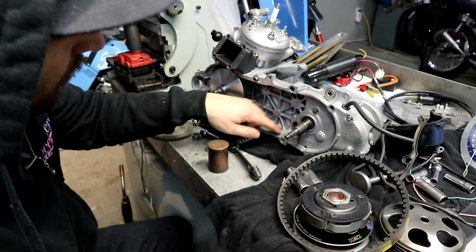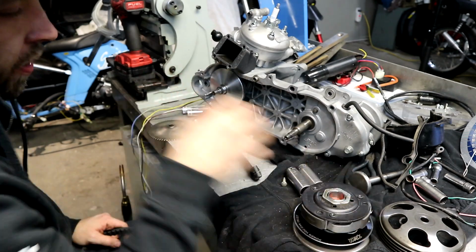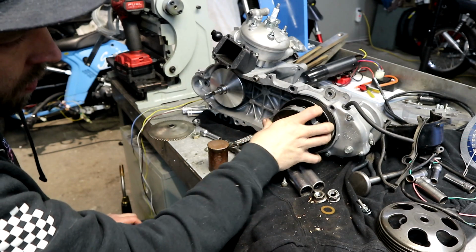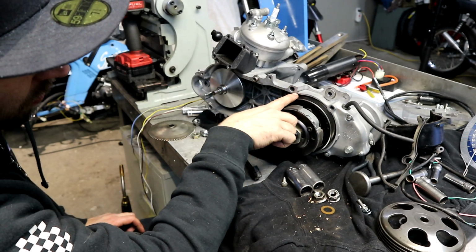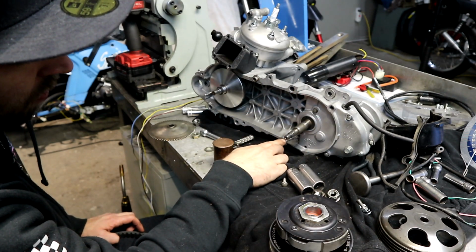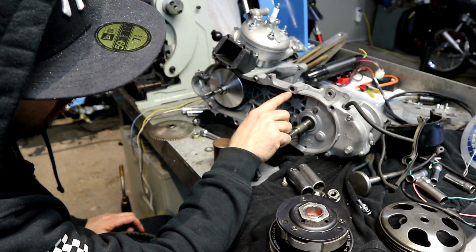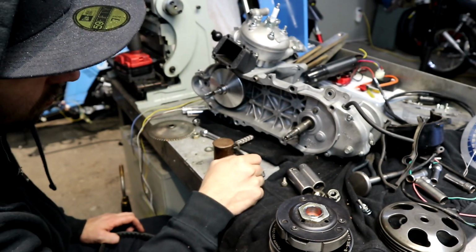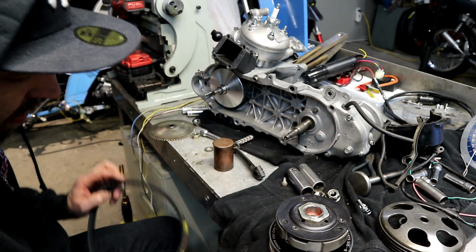And there is one more thing I'm going to have to do. When you're running these pulleys, with the grinder as well, the belt rides up so high that it rubs along the edge right here and also on this. So you basically need to remove that lump, flatten it out completely, and the same thing here, flatten this out up to the edge of the external case here. And you'll see wear marks on there and also on the belt.